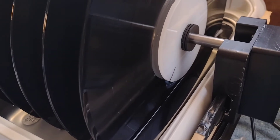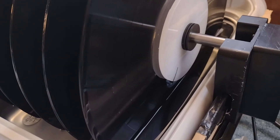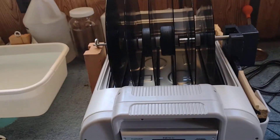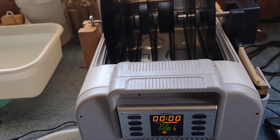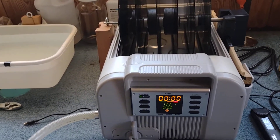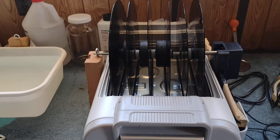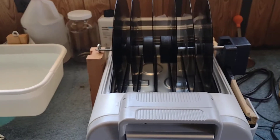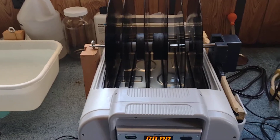As you can see, it's turning very slowly at about 0.5 rpm. You have to fill it just a little bit above the fill line in order to cover to the dead wax without the records hitting the bottom of the tank. You may have to go about an eighth of an inch over the fill line, and I think if you're careful it's probably okay.